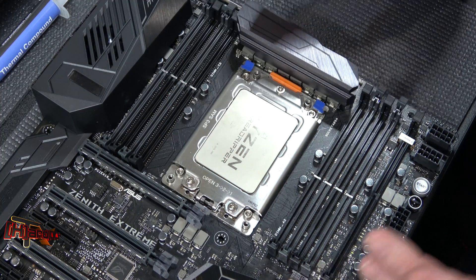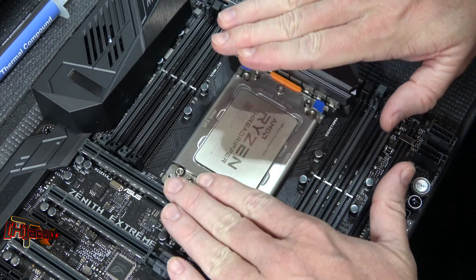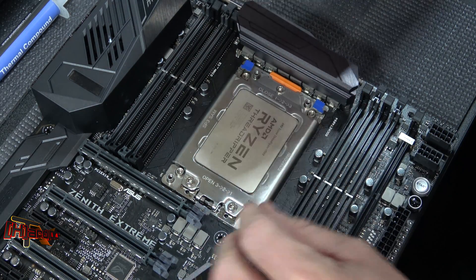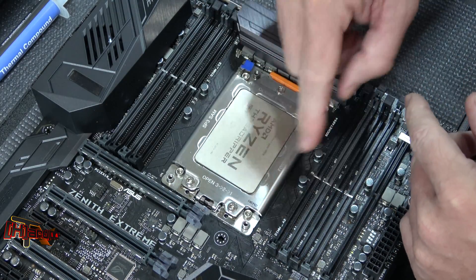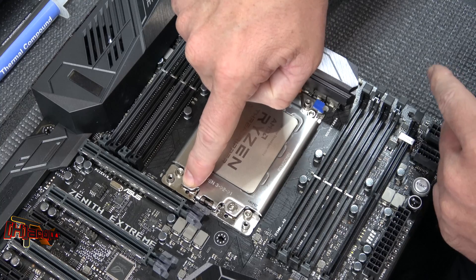There you go — that's all there is to it. Get your screws lined up to make sure they start evenly so you don't have that socket floating around on top, which makes the back two very difficult to get into place. It doesn't take much pressure pushing down — just turn it backwards until you hear those threads snap into place, give a quarter turn, do that all the way around, then follow closing order 1, 2, 3 and torque all the way down.